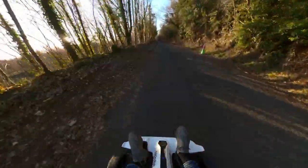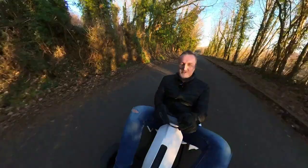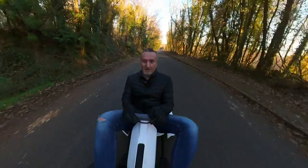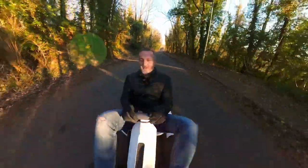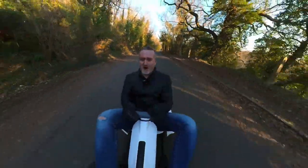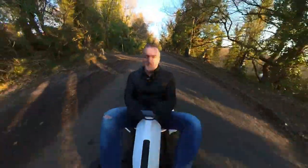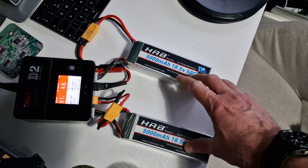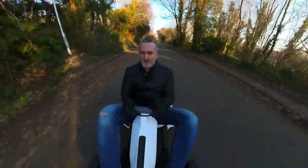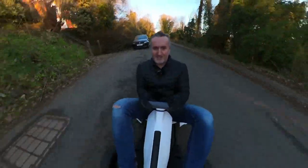More experimentation to be done, but if you want to really increase the power of your go-kart, just parallel a LiPo pack in parallel with the existing battery. I've got to charge this separately — it's made of three 5S 5000mAh bricks, so I can just take them off and charge them on one of my RC chargers, which I use for my RC stuff. It's actually the perfect solution.